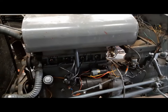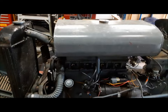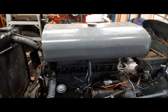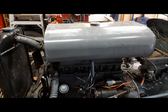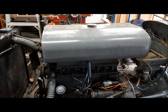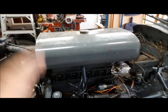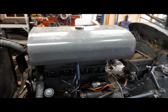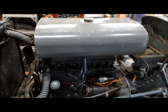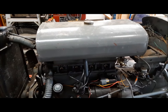What I've done now is drained the gas out of it — we're going to pop the gas tank off. I'm going to pull the valve cover off and, even though I lashed the valves last time it was here, I'm going to double check the valve lash. If that looks okay, we're going to put the remote fuel system on it, fire it up, put a vacuum gauge on it. That'll be our last test once we know everything else mechanically is good.